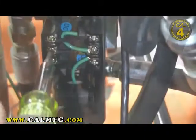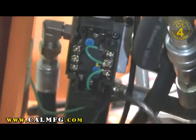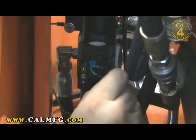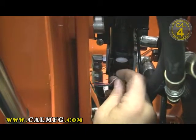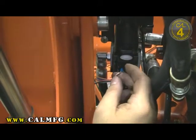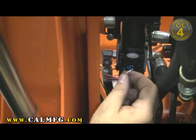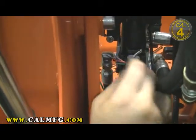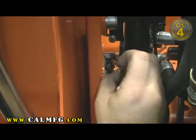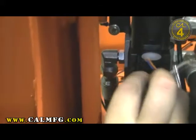We're going to go ahead and pull the clipped wires out now. We're going to measure about how much cord we need from the handle that we just fed down here and go ahead and cut that cord off. These two switches are independent hot switches, and for that reason we have to tie together the brown and white wire — I've gone ahead and trimmed those back. The green wire will go to one of our coils in this valve and the blue wire will go to the other coil.